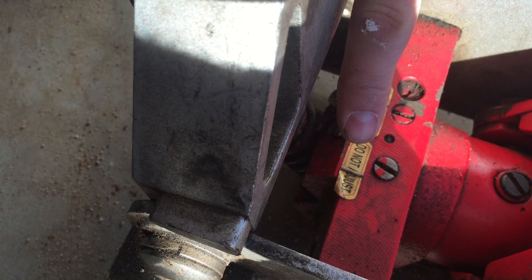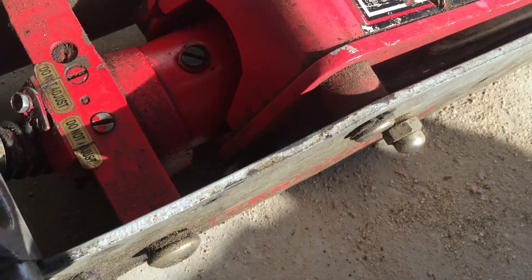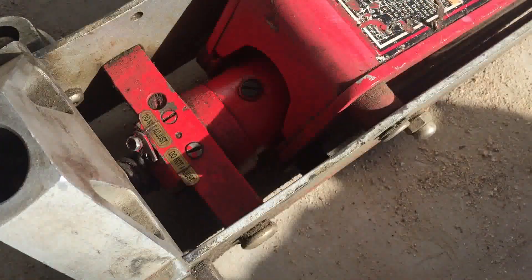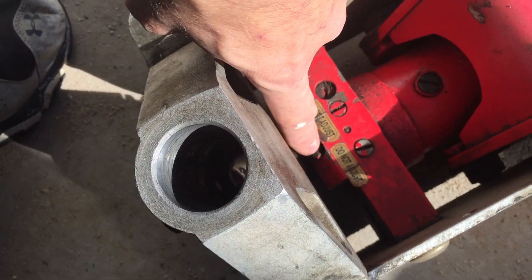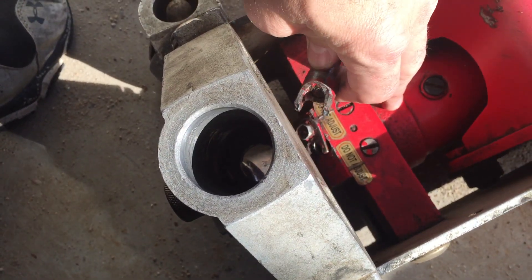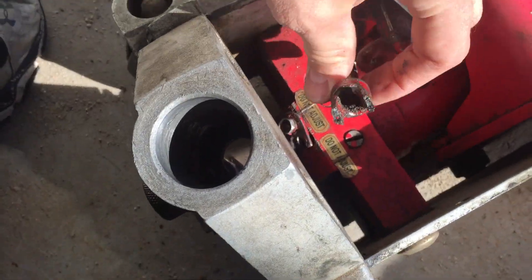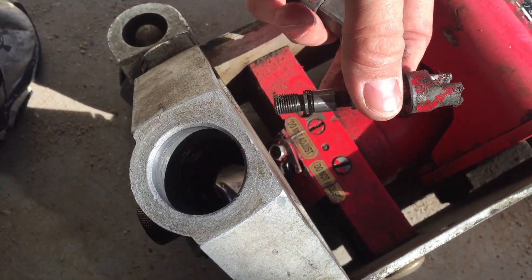So what happened — right here is where the universal joint goes. Your handle goes in here and it's supposed to spin this guy right here. It spins your universal joint and will either tighten or loosen this plunger that's inside the cylinder. That either traps the pressure so it can't get out or relieves the pressure so your jack will go down. When you crank your jack handle all the way to the right, this little guy tightens up so pressure stays in the cylinder and raises the jack when you pump the handle. What happened was when I was tightening it last time, this universal joint broke — it's got a lot of time on it, probably from me over-tightening it.